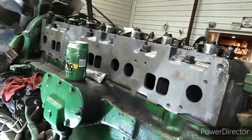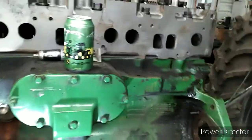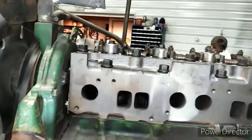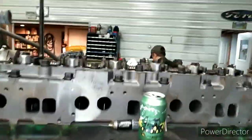After the valve cover, probably intake and exhaust. I'm not going to put the valve cover on - I'm going to actually start running it and readjust the valves. I'll run it for a few minutes and then readjust. This was sitting open so long, we didn't pull the lifters out or the cam, so there could be debris on them. Probably have to readjust the valves a few hours down the road too.